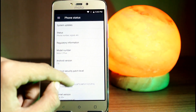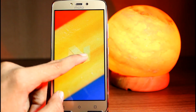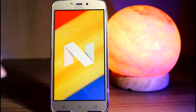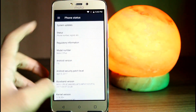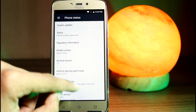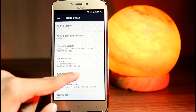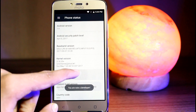This device comes with Android 7.0 Nougat out of the box, so you can expect an Android 8 update. Sometimes I felt that this phone becomes sluggish, and to solve that simply go to About Phone, rapidly tap on Build Number, access Developer Settings, and change transitions to 0.5x.